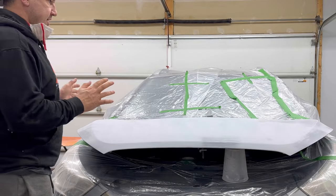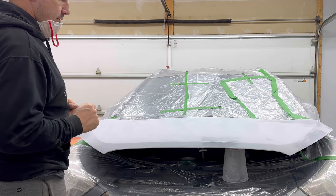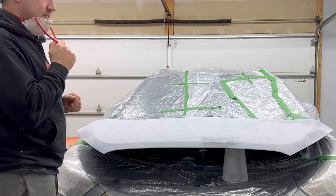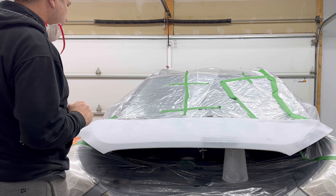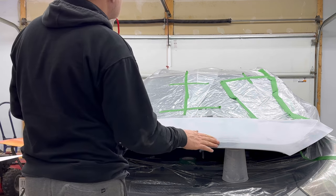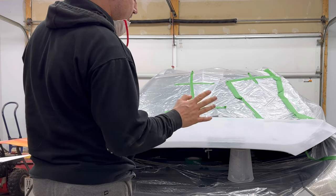Okay guys, so let's pretend you're doing this at your house in your garage. You definitely want your N95 or equivalent mask. You're dealing with chemicals, dust, all kinds of stuff. I did burn through in a couple places. I went and I sprayed down some etch after, just to deal with those. The 400 like we talked about, and then finished in the 600.